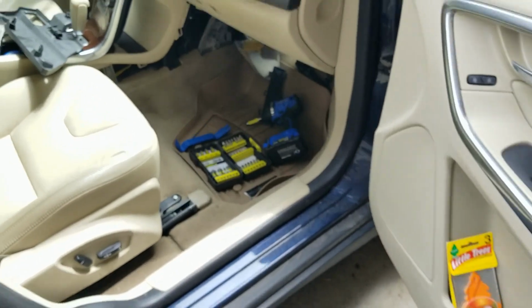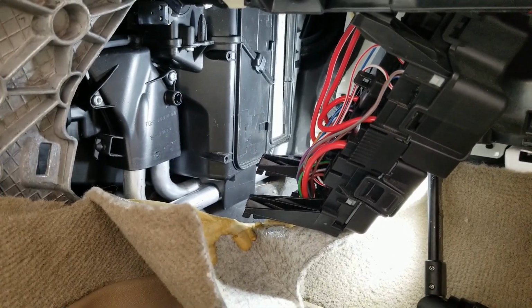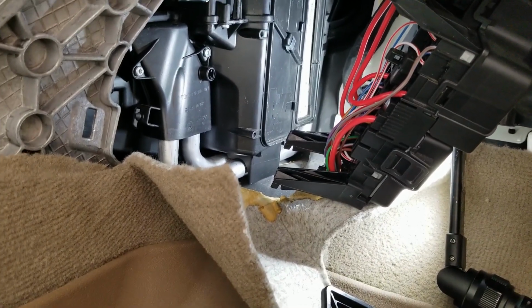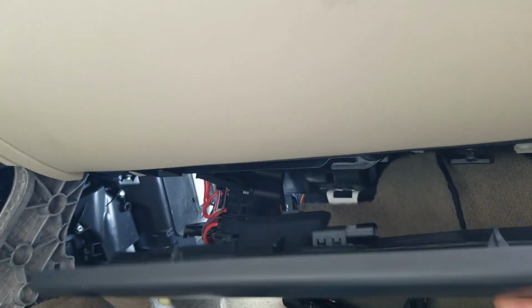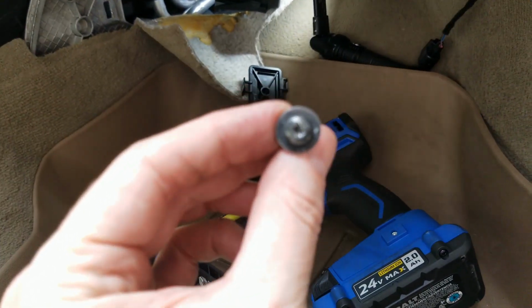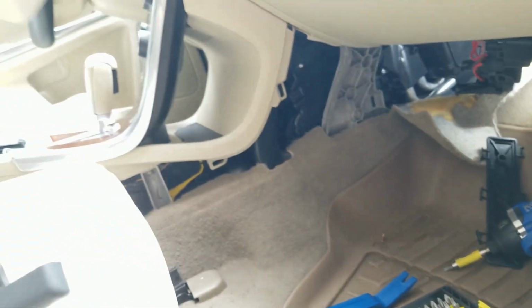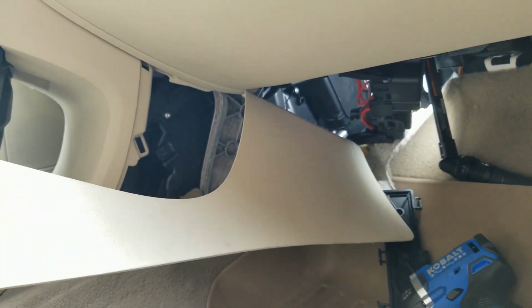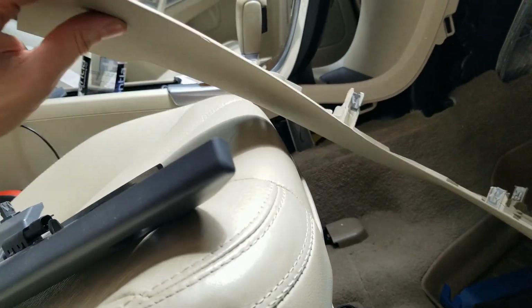And right now with the front, what I'm working on is the cabin air filter. I did the regular air filter and changed the oil. Oil filter is new. And now we're on cabin air filter from inside the vehicle. Basically what you got to do is remove a panel here with two Torx. I believe it's T25s. Torx bolts here. Those come out. You can see an example of one of those rascals, T25. And then you pop off the side panel, which is here on the side, and it's just one of those compression fit, expandable clips.